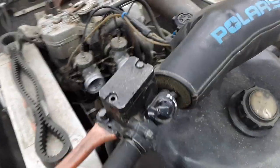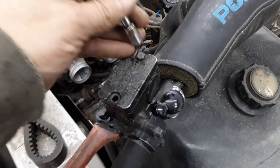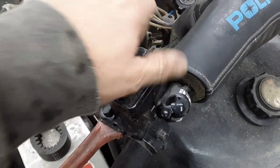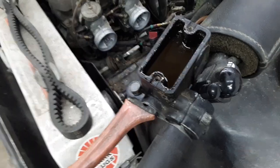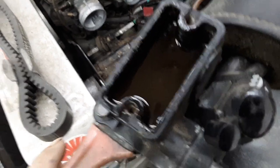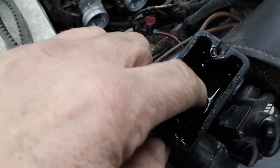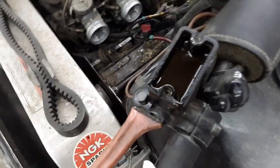Using a 5/16ths nut driver I removed these two screws to see if there was any brake fluid in the reservoir. As I took this off, a little rubber piece comes out and exposes the reservoir, but as you can see in there it's very muddy — the best I can explain it is very like oil or motor oil almost. Brake fluid shouldn't look like that; it's more of a clear.